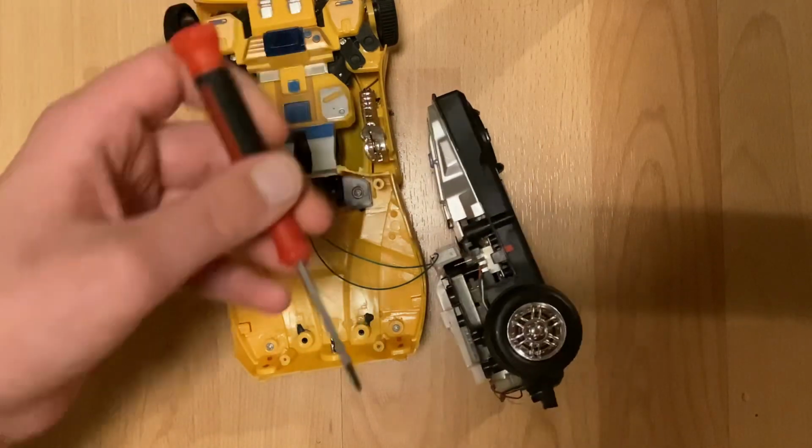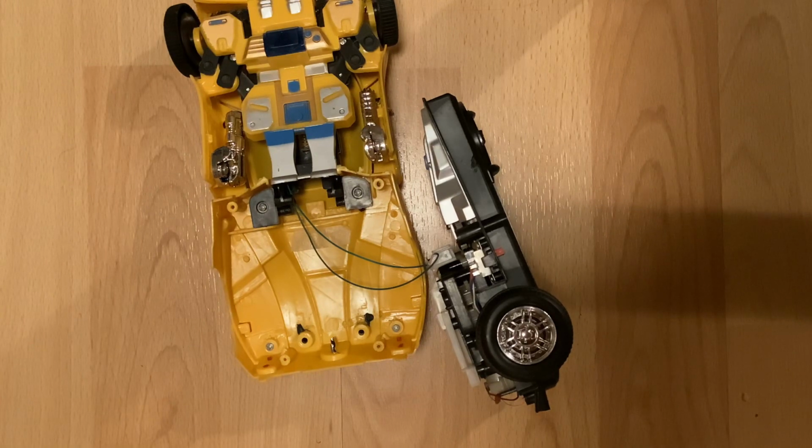That little dip and pitch that we heard is good. If it's just a short dip in pitch, that's good, because that means the motor is having force put on it. If it is a long dip in pitch and it continues even after you stopped moving things, that is bad and you want to stop and turn it off as soon as possible because that means that something is breaking.